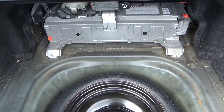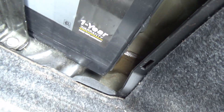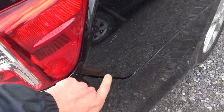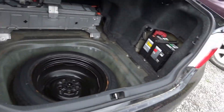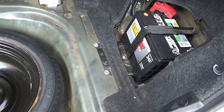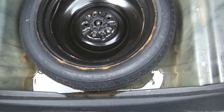Gets hot, moisture everywhere condenses on those wires, and then boom — you get another short. So I asked them: do you want me to diagnose the source of the water leak? Because without that I can't guarantee my repair — this is going to happen again. He approved an extra hour of diagnostic time. We got some trim off; I want to take off this trim piece here so we get a good visual.